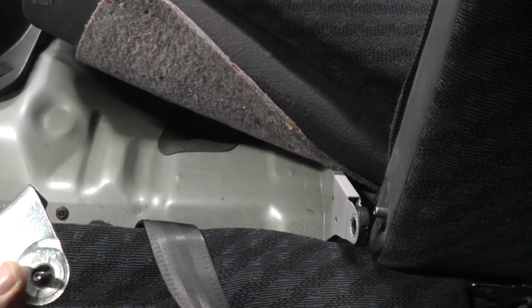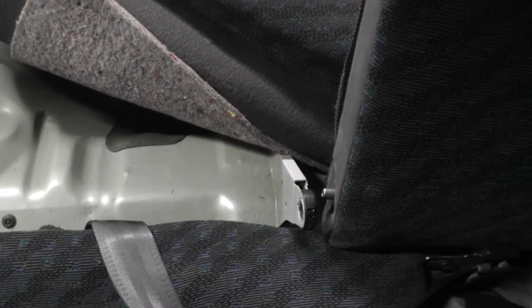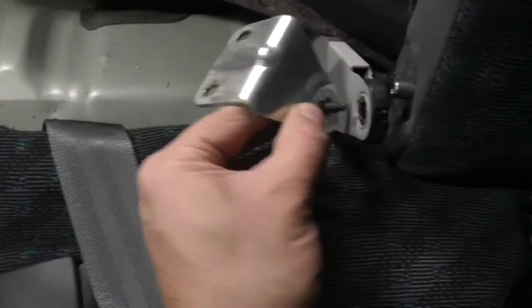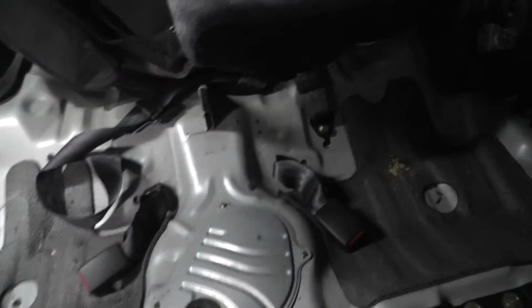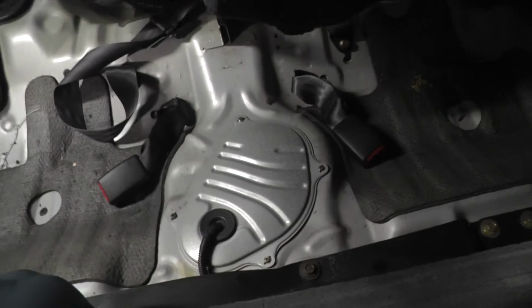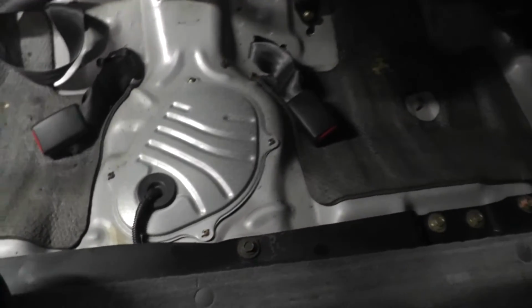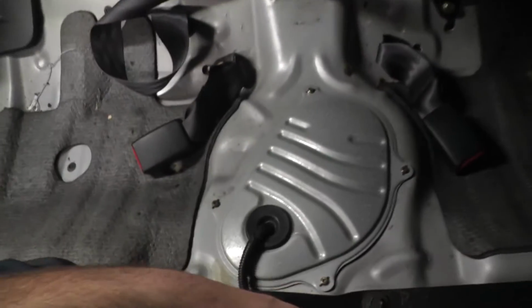So there's probably a few people thinking I'm pretty stupid here. Maybe I am. Basically, I've never taken one of these back bench seats out of an EK before, or EJ. So you just undo that. And then popping the seat forward, you can just pull this thing out, which goes on there like that. So that means I can finally take the seats out. So just pulling that up, got this seat out, and it's got these kind of pegs at the bottom here, which are pretty happy in their location. I don't think any of this has been moved for a long old time. Either way, easy enough once you know how, which I didn't before, but easy to work out.